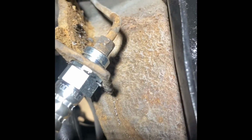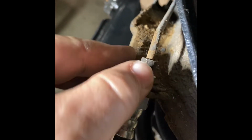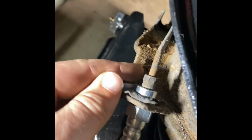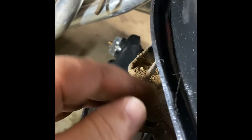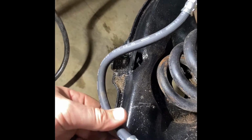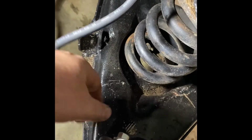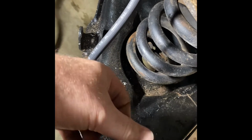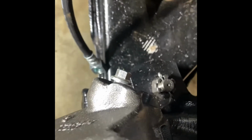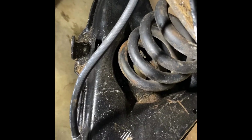It stops on that side because of that snap ring, but then now it's high enough where I can lock it in with my existing clip there, and then I'll tighten that line up. And I'll probably end up replacing these lines eventually later, just not right now. They seem to be working just fine. And then of course right here, banjo bolt. The torque on that is 33 pounds for anybody that needs to know that. And the bolt is a 7/16 socket, 33 pounds. I already did the other side, so this is my last side.